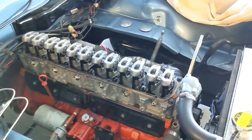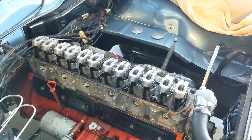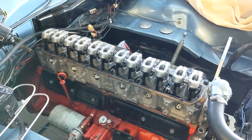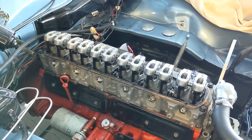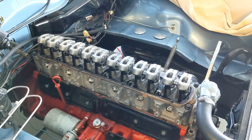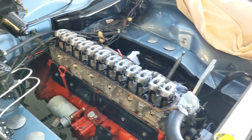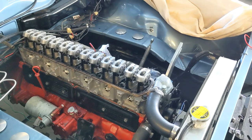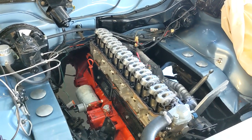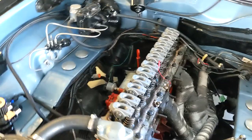We're going to completely pull this head apart, pull all the valves out, check it all out, check all the valve guides, check all the angles on the valves — just make sure it's right. And we will be CC'ing this head to bring the compression ratio up. This was originally bought as a 72cc head for the forced induction, but on the 173, it really lowered the compression. Shane Barnett suggested we get up to 9.5 to 1 compression ratio, and we're decking the block down flush with the pistons to achieve that.